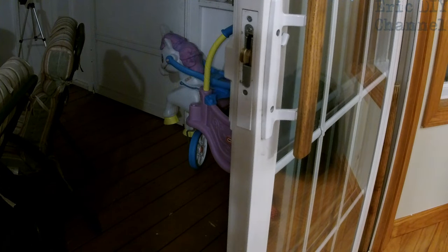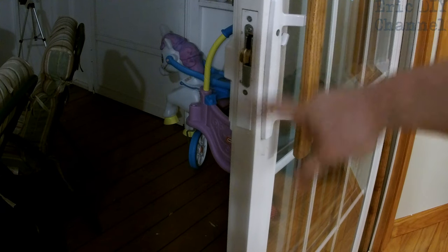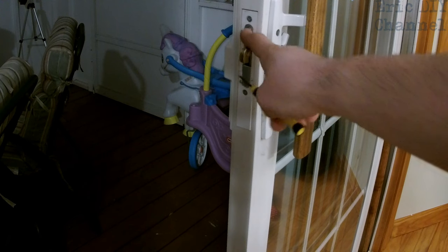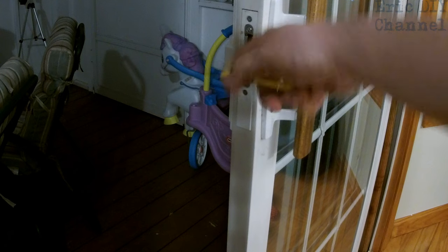That is how you repair the mortise lock on your sliding glass door. Sometimes it can get stuck, so you might want to put some silicone or lithium grease in there — sometimes that makes all the difference. I'll leave a link in the description so you can buy your own mortise lock. Remember there's an adjustment screw here: if you tighten it with a flathead it makes the hook go out, and if you loosen it it makes the hook go in, depending on the catch — you can adjust the hook in or out.